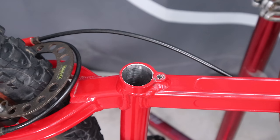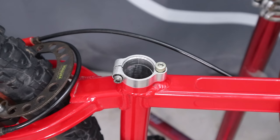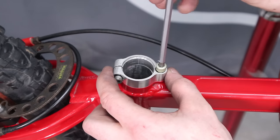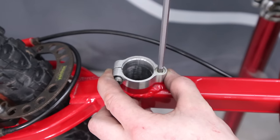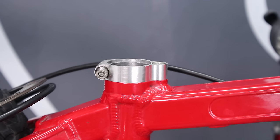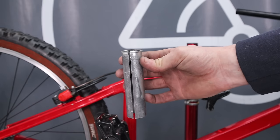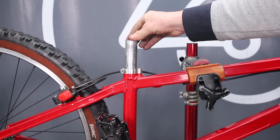There's no wedge system nor any exposed frame to squish with a clamp — you have to use their special clamp. I actually think this is a really clever system. Traditionally you flex the frame to clamp around a seat post — this works but it isn't ideal as flexing aluminium eventually weakens it, and it's not uncommon to find cracks in older frames around a seat clamp area. Instead Pace swap the exposed seat tube with their own clamp held in place with a single bolt, eliminating flexing and a potential weak spot. The top of the clamp also has a little recess so when I fit a shim it sits totally flush — you'd never know it's there.